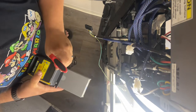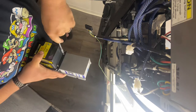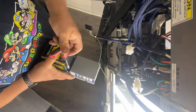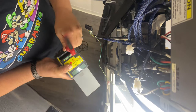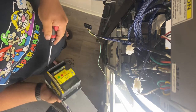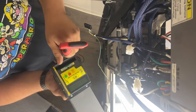If you don't have your card reader hardware yet, you can still do the bezel swap. The bezel just will not power on until you get the rest of your equipment. The bezel is in no way powered by the harness for the bill validator — it gets its power from its own power cord and from the telemeter from your card service provider.